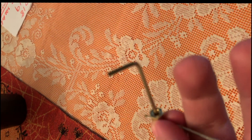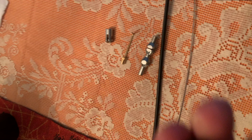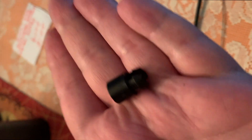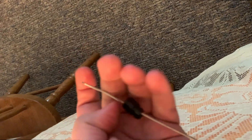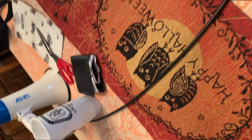I have the whole assembly apart. My stock third-gen pedal had this little plastic piece — I cut the cable off and removed the plastic piece, and I also cut the grommet. So we're going to reuse this piece to attach the throttle cable to the pedal, and use the grommet that went into the firewall. This goes on this little cable right here — I believe it faces down — slide it all the way down. Now it's on the pedal side, the red side, and we're going to slide it back on here.